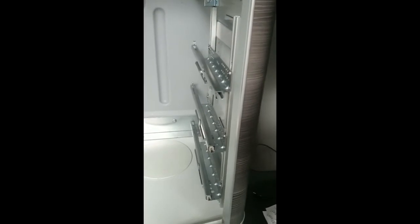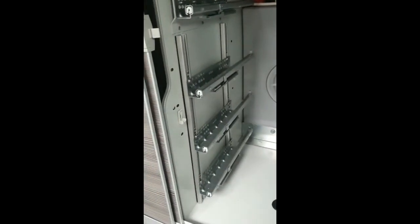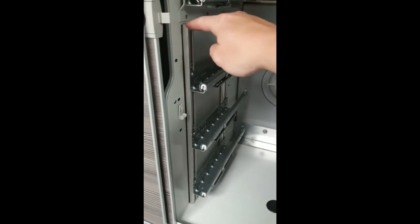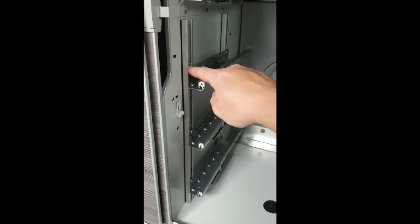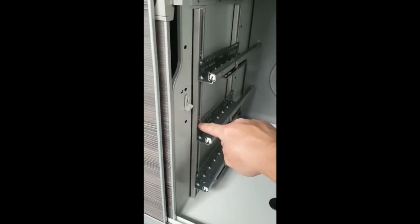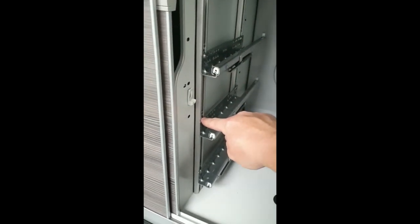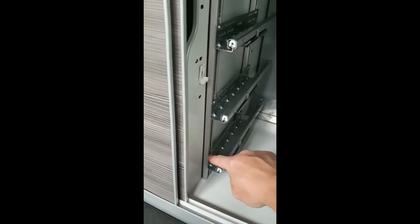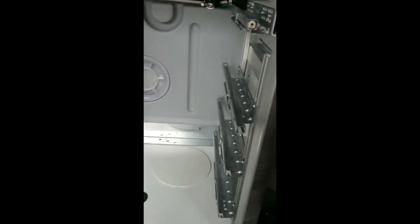When the brackets are manufactured, we measure from the top of the bracket down to the top of the first runner: 8 centimetres; top of the second runner: 20.5 centimetres; and the bottom of the third runner: 33.5 centimetres. Let's put the drawers in and see if they line up.